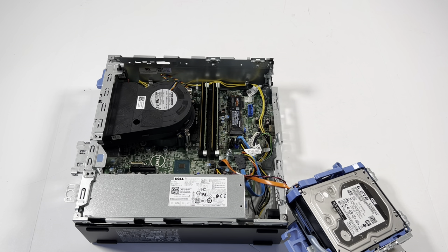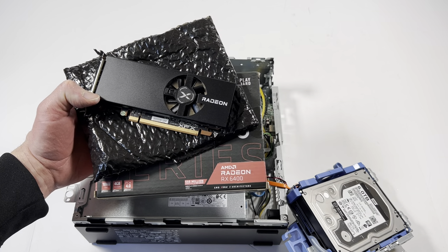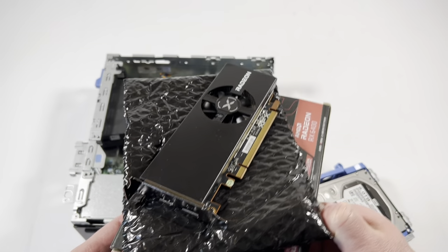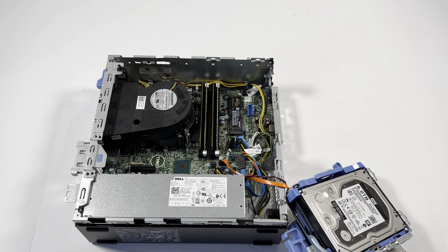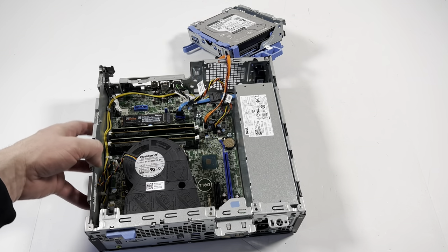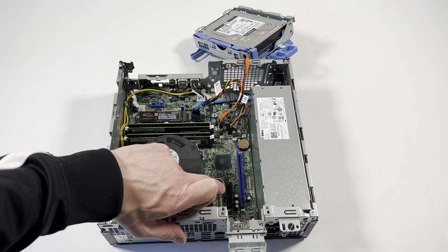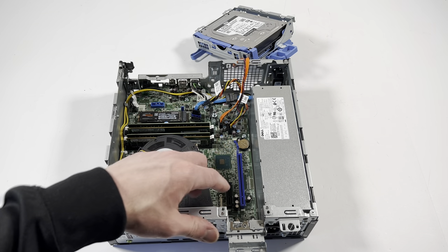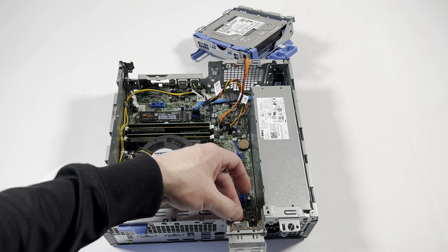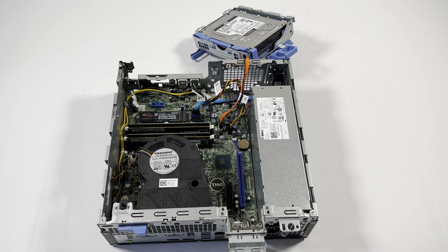Now I'll install the video card. I just bought the AMD Radeon RX 6400 — it comes with a full-height bracket, but you'll have to change it to the small low-profile bracket that's included. I'll put a link in the description. I'm switching to the other side so you can see better. Remove the PCI bracket — the top slot is PCIe x4, but we're installing in the bottom one, the PCIe x16 blue slot. The top bracket is mounted to the case so you'll need pliers to remove it.